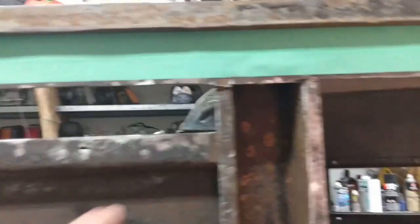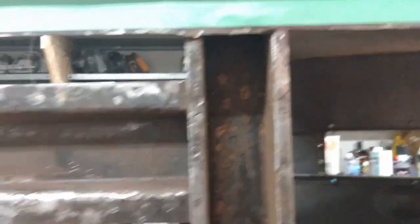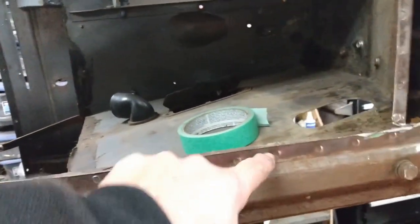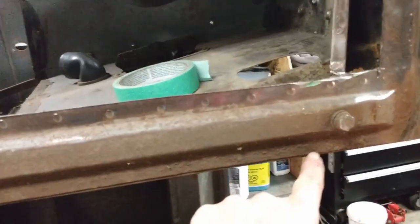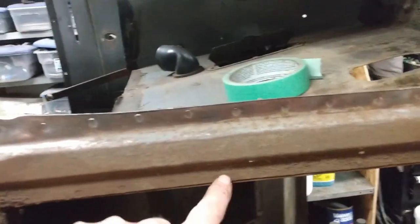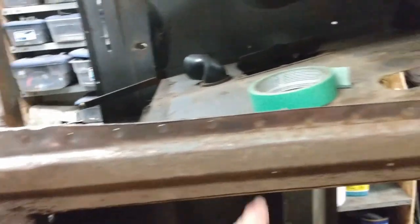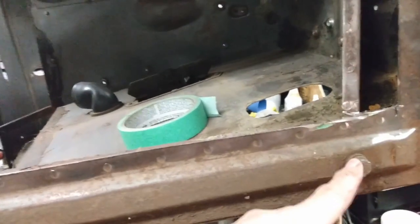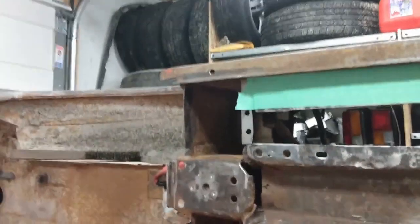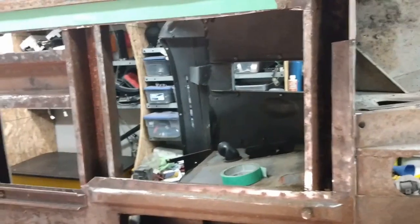I'll still do the plug welds from the top side down here, plug welds from the top side along this edge. And then I'll plug weld from the bottom, from the side that's facing us now, along this side. So I'll punch the edge of the floor pan where it goes along here, and put a new captive nut in for the ground or the earth bolt. I think I'm just going to leave things the same plan at the back end here, as I just think that's going to make it a lot easier to put things back together if I do it that way.